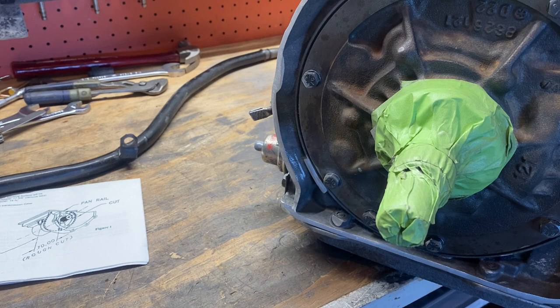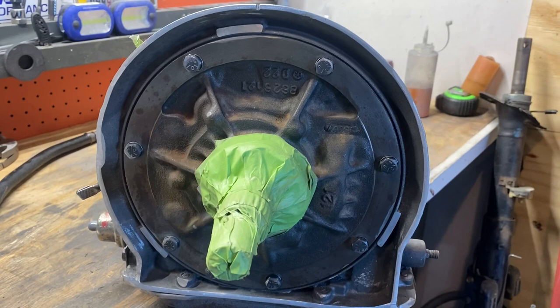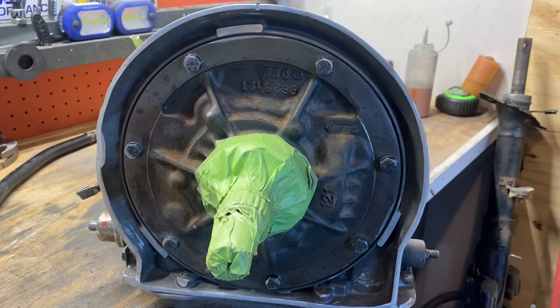That's my quick video for the day. I've got to get everything loaded up to head down to David's to use the lift to swap these transmissions. I've fought with trying to put the ultra bell on by myself without dropping all the O-rings — you're going to have to be patient. I bought a fixture to try to turn the transmission vertical, because everybody says installing the bell is way easier with the transmission vertical. The fixture I bought was junk — not strong enough to hold the weight of a Turbo 400. Thank god I didn't drop it on the floor. I also found out that even my bigger wooden workbench without being bolted to the wall, the weight of a Turbo 400 can flip it over.